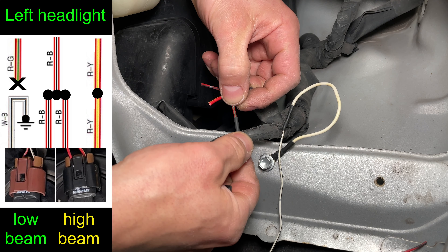Let's start by checking out the old headlights. Each side has one light bulb that switches between low beam and high beam filaments. The headlights can be adjusted up and down with an 8 millimeter wrench by turning this bolt. Let's do the garage door test to make sure the headlights are even with each other. That looks good. Out in the street you can see the low beams have a very smooth beam pattern and the high beams shine a lot farther.